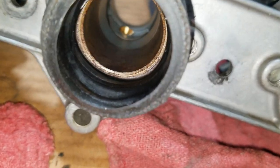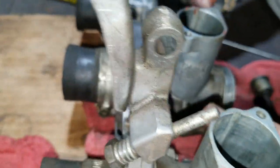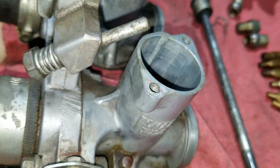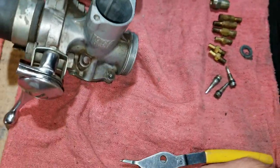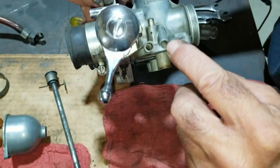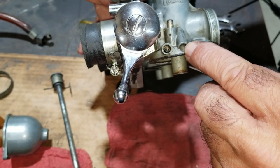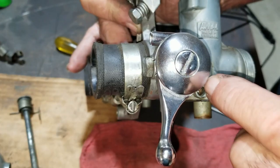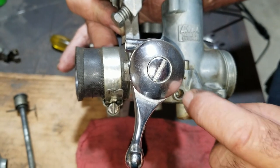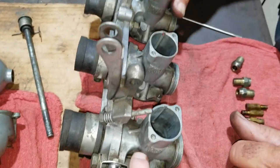Alright, so if you had one of these carburetors on your little bike that had one of these small handles, and you had this on there, I guess you'd know this is for a Trident instead. Or vice versa. Well, it wouldn't be drilled for this, so you wouldn't be able to set your idle on a 250 or a 500. You'd only be able to set your air for idle for your pilot. Yeah, so it still has the tickler and everything. Yep.